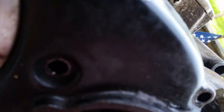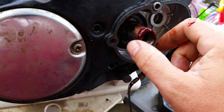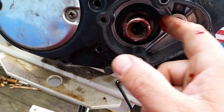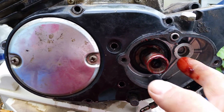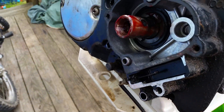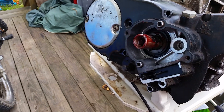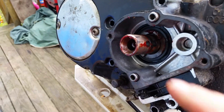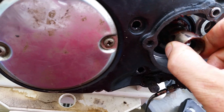Make sure the shifter goes through. I put grease on the back side of the seal as well — I've already done that. Then just gently tap it into place. Once it's in place, grab any extra grease and lube the whole shaft. Now there's a tricky part — you see all those holes on the shaft. I've got the transmission in neutral.